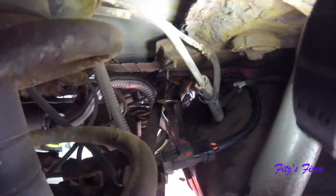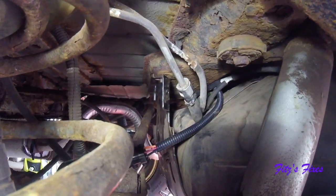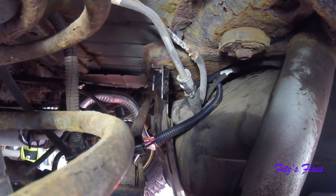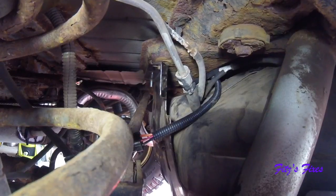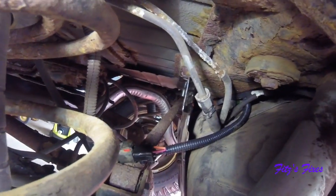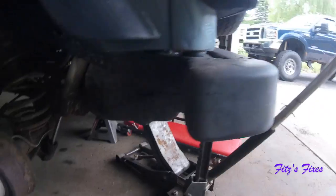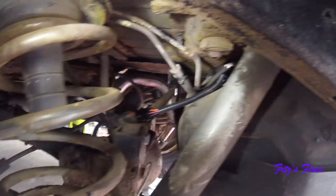That bolt back there - the shiny one - I didn't have those little retaining clips to hold those bolts, so I just hit it with my welder and tacked a little bead on it just to make it so it doesn't spin. Now I should be able to get the nut on there. It went a little easier than I thought. The back piece wasn't lining up with those two bolts, so I took a pry bar between the torsion bar and the skid plate and pried a little without tension on the jack, and when the holes lined up I jacked it up and they fell right in.